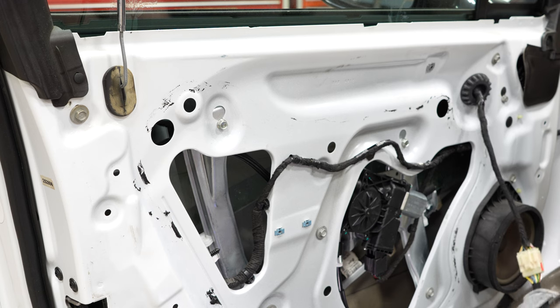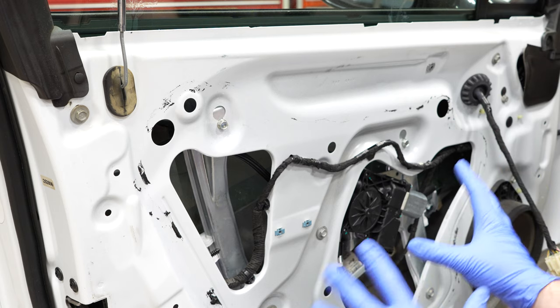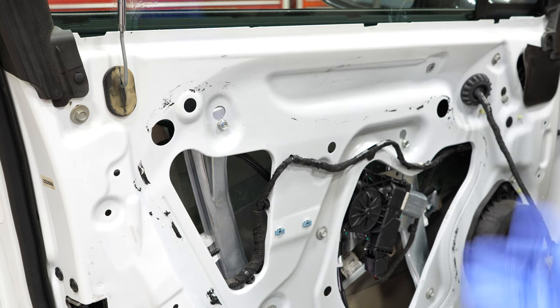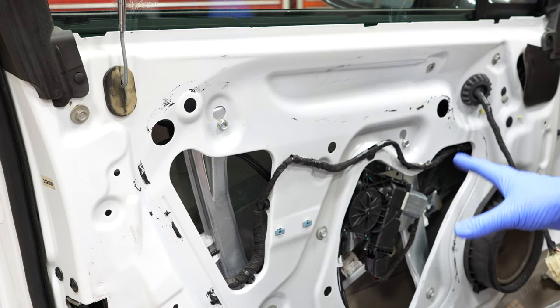Before doing anything else, we need to verify this is going to work. I've plugged in the door panel and I'm letting it hang for just a moment. I have to have the car on so it'll do a bunch of bonging. This motor has a little computer in it that needs to learn where down is and where up is for the auto up/down convenience feature. What we're going to do — and this is a little scary — is go all the way down, hold the switch for three seconds, then immediately bring it up and hold for three seconds.